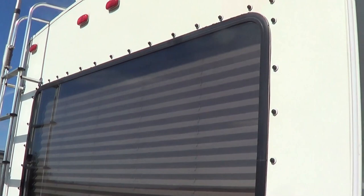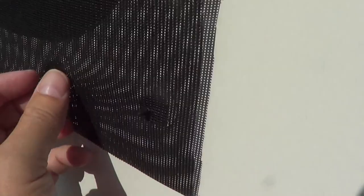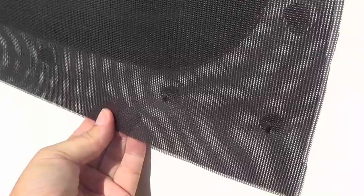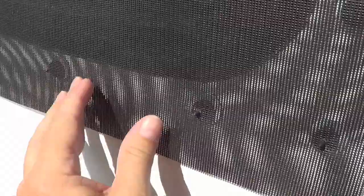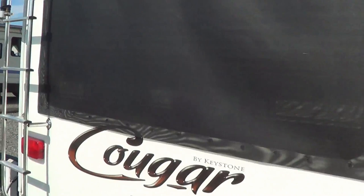Okay, so now we can hang the material up. Hey, that looks pretty sweet! I've just tacked on a few of those by pushing them through the material — it's warm out and it goes through pretty easy. They also said this is a non-elastic fabric, so you don't want to stretch it to put it on each stud because what'll happen is it'll build tension and it'll be pulling on the stud. So you want to make sure it lays nice and flat between each one when you press them on. You can pull them off and readjust for any wrinkles — might have to pull that corner off and get rid of that one wrinkle. I'll continue on and get it all nice and laid in flat.